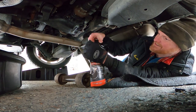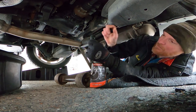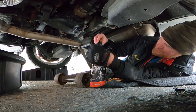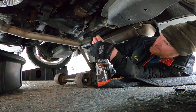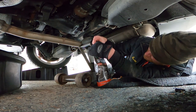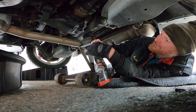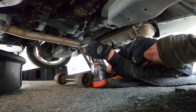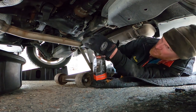My rear gear oil survival kit is in a wheelbarrow. We're going to use this stuff and get to work. Amsoil tells me that this SVG — Severe Gear — severe gear oil is designed for this open rear end. The all-wheel drive does not have posi, so this is what should go in there. I like that they put it in this flexible bag so I can squeeze it around. I'm going to cut it about here — hope for the best.